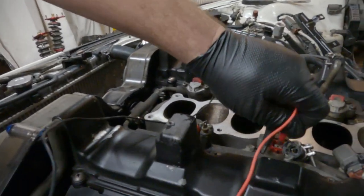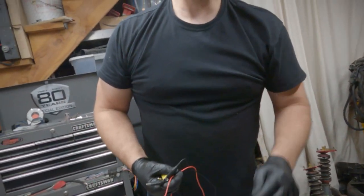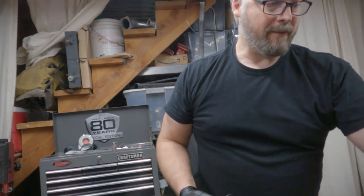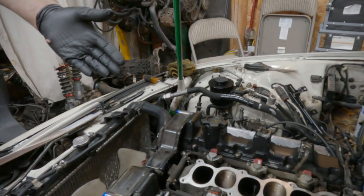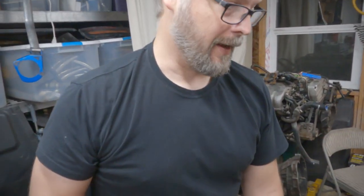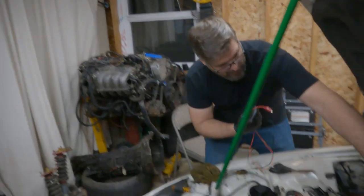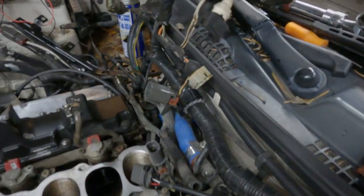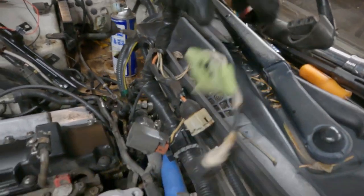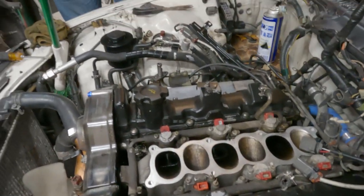All of them sounded pretty much exactly the same, including this one which wasn't working. So we might be suspicious of wiring on that one. Just because we have the same problem in two cylinders — that the injectors aren't working — doesn't mean it's the same cause. One of them, clearly the injector is dead. The other one, maybe it's wiring. As a matter of fact, the wiring had been redone on this back one. I think there's a decent chance that number four just had bad wiring to it.